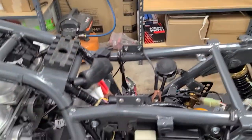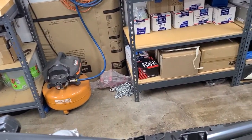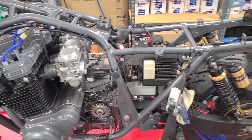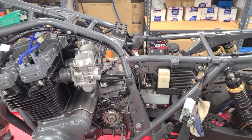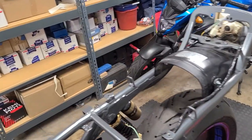The coils work. The engine will click over but the battery is just lame — it's completely shot. I have an anti-gravity battery. I turned the bike over with this battery too, but it's just not holding a charge. That's why it's over there on the float charger — it's blinking.